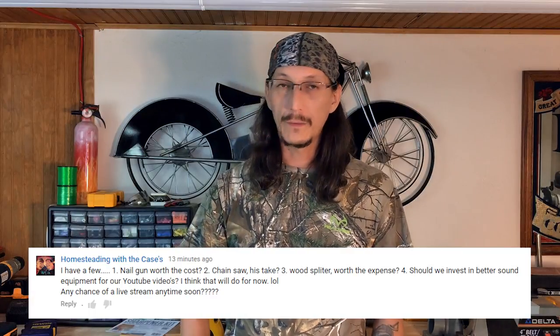Chainsaw — what is my take on a chainsaw? My first chainsaw was a Homelite, and that was the chainsaw where I learned the lesson on ethanol gas and not to put regular pump gas in your small engines. It'll just gunk it up and ruin it if the gas sits in there, because they're not made for straight-from-the-pump gas. Cars and trucks are made to run pump gas. Small engines like leaf blowers, weed eaters, chainsaws need to have Stabil or some sort of gas stabilizer to prevent it from getting all gunked up. So that chainsaw got ruined. Then I had a Husqvarna, which was a great saw, but I ended up selling it thinking I wouldn't need it anymore. Then we started homesteading and it was time to get a chainsaw again. If you heat with wood or you are cutting firewood, get a good chainsaw.